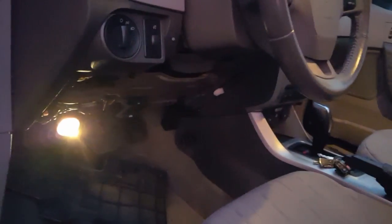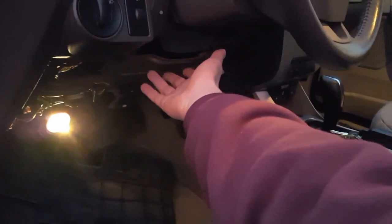So what I did is you have to reset a fuse. There's a fuse specifically for the Sync system. Now to make it fun, you have to get clear underneath the steering wheel here, and there's a plastic panel — you just yank it off, just pops off here. And there's a fuse box in the most possibly convenient location, right through this little crack. And if you have big hands, you can barely even fit your hand through there, but that's where most of the fuses are.